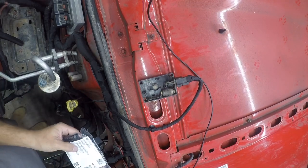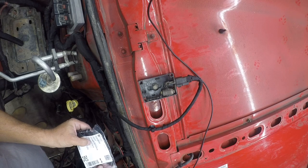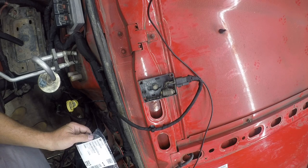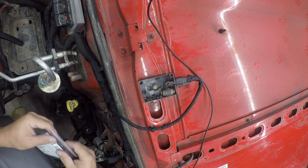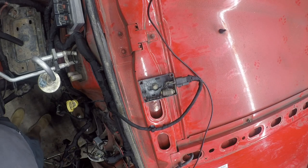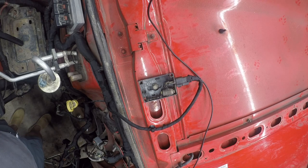That was part number PUM071M30 — it's a 6.3 millimeter cable tie mount push mount style from Panduit. I'll put these part numbers in the description because I think these are going to be very useful for anyone else restoring or building a Jeep. If you have a project Jeep and the engine out, I really think you should go through the wiring harness like I'm doing — it could save you a lot of hassle in the long run.